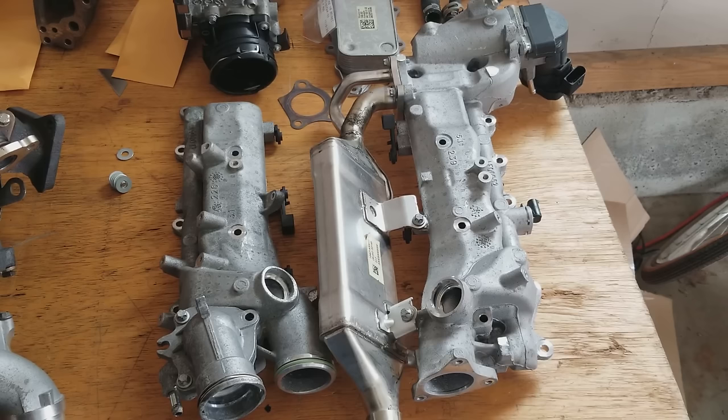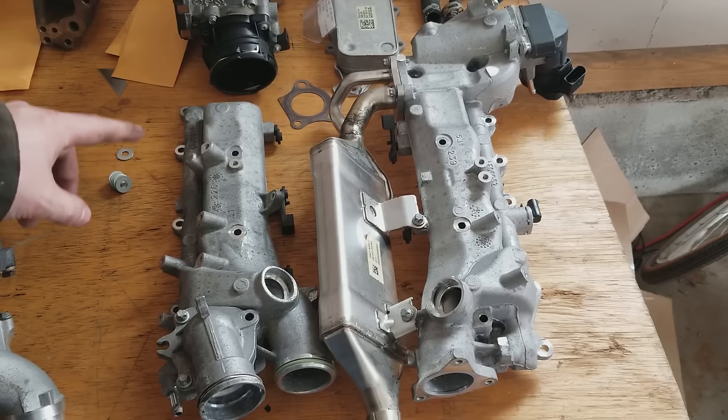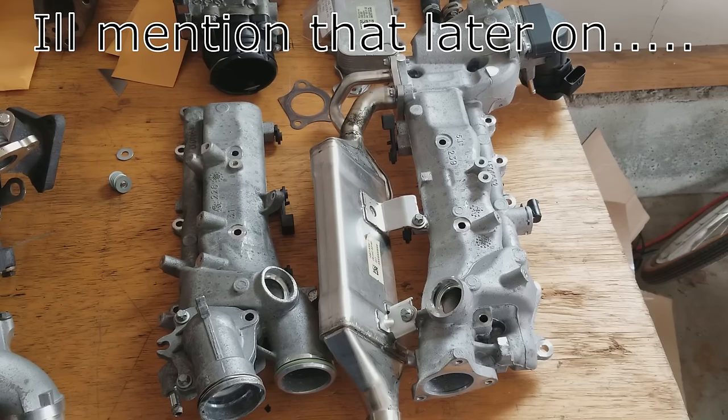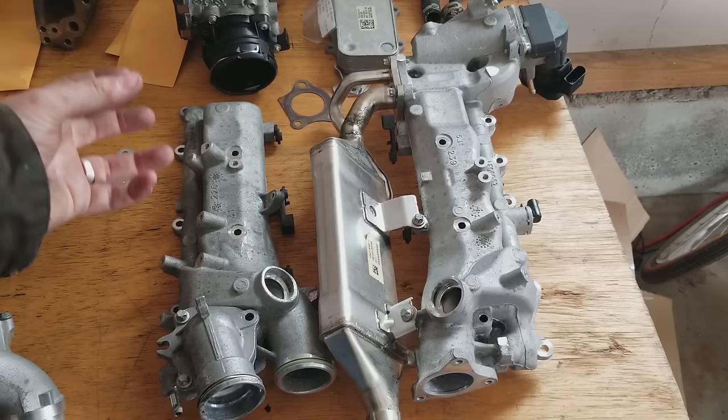There's one right here on this thermostat housing. This goes all the way through to the head. And then there's also one far back here in the back, you'll see when you get to it. And that's pretty much it for the intake manifolds. Once those bolts are taken out, the intake manifolds basically just drop down. A trick for getting these out is to take both fuel rails off of the engine in order to pull this out. It comes out in one piece very easily.